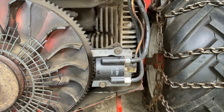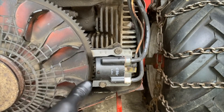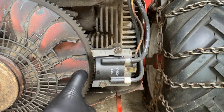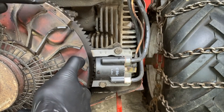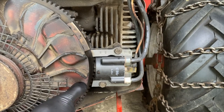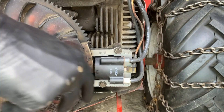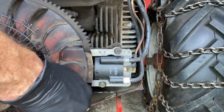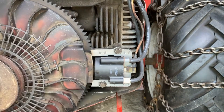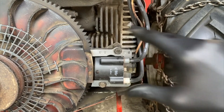The way I'm going to do this: first, I'm going to carefully rotate the flywheel and fan blade assembly clockwise until the rotor meets the coil. Go slow — no need to rush this. And here comes the rotor. This little block part here — it's basically a magnet, so it's going to connect right there. I want to center it right there in between both of them. As you can see, I have not tightened these bolts and it is spring-loaded — again, magnetic. And we need to set the proper gap.